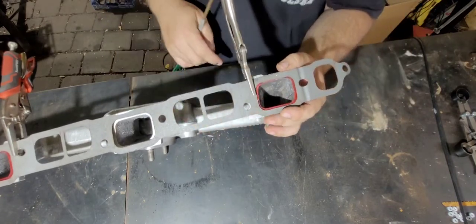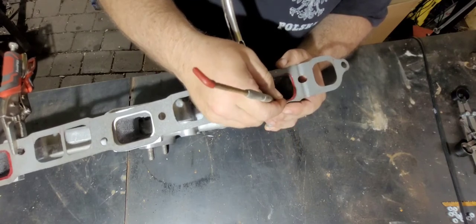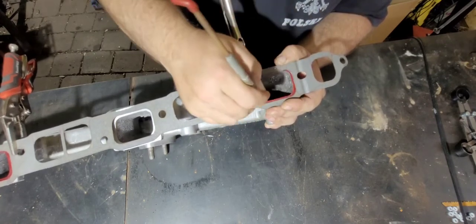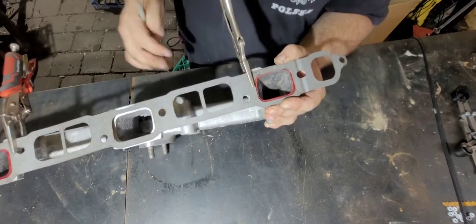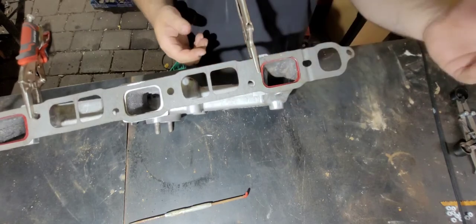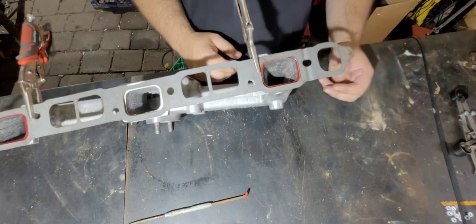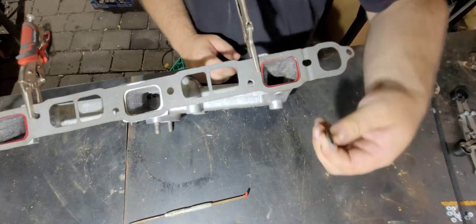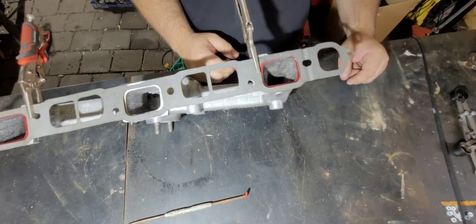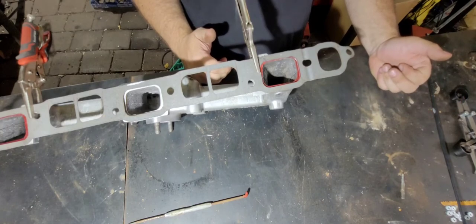Before you go commenting — it's just an old gasket, so don't stress. It's only there to hold it. I just use this gasket as a template. Now you may notice that the bolt holes here don't quite exactly line up with the casting of the manifold — that's something to look out for. You'll have to get an old bolt with a point on it as a punch, or a little rat tail file or wad punches if you've got them.